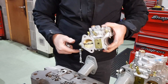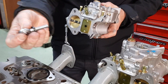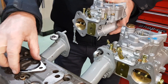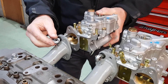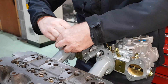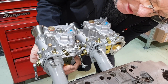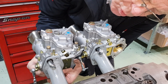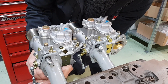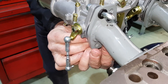We only use nyloc nuts here. This is the one that we've machined in half. Rose joint with the washer. Carburetor — hold it in place. Make sure you get the bolt going through the MYSAB plate and then through the manifold. Pop the nut on loosely.